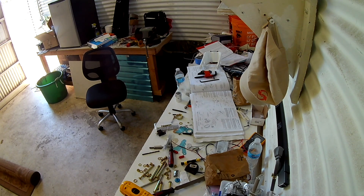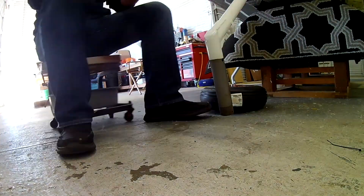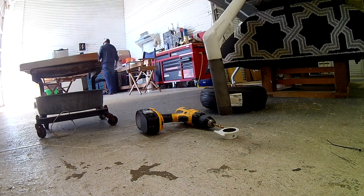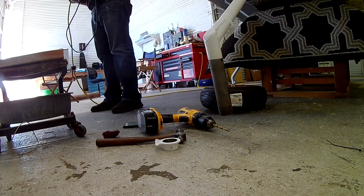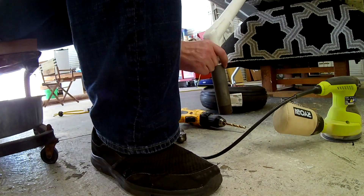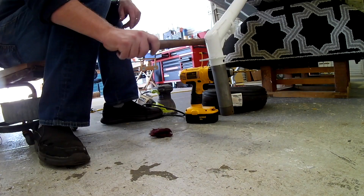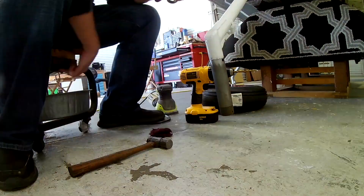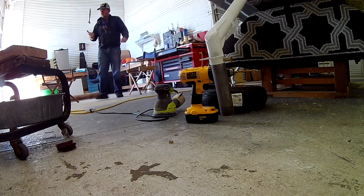So we're talking about the front landing gear, which is what we're going to work on now with the gear leg in place. It's not too difficult. There is the big front fork — it's hard to tell but it's actually up on that desk because I've had it powder coated white. The original one comes not powder coated; I decided to powder coat mine because why not. There's that collar you can see me messing with — that is what keeps the nose wheel from castering a full 360 degrees. One of the things Vans tells you to do is sand up that column, which I did — I used a little orbital sander with 320 grit paper to make sure it's nice and smooth.